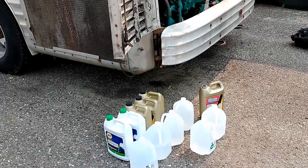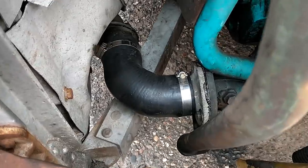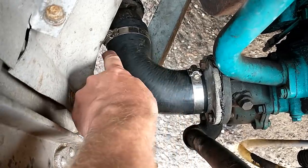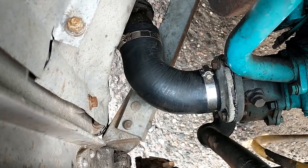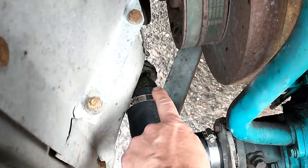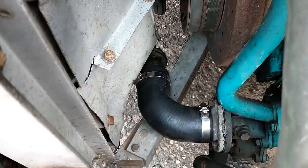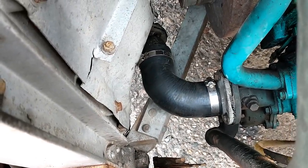Last time we were here, we flushed out the cooling system and repaired all the coolant hoses we could get our hands on. We actually had to modify that lower piece. There's been a few questions on the Grease Monkey forum about how to do that. Basically, you cut it in two parts — a cut here and a cut at the top — then you replace that section with a rubber hose because there's got to be some flexible couplers in there. We took out the original couplers and used some Right Stuff gasket maker and bolted that on. The lower one, you have to drill three new holes to bolt the flange back on because the original couplers had three offset holes. This is 57 millimeters — actually 62 millimeters on the tube — but you can stretch it over. It's a nice snug fit and it seems to work well.